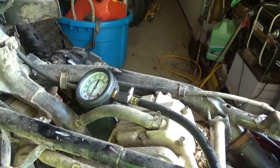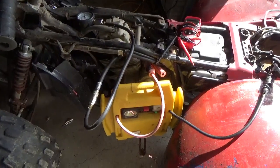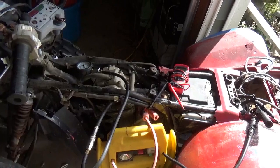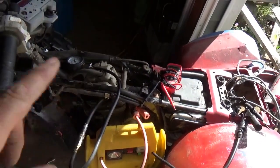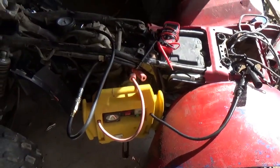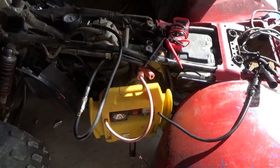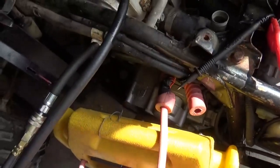I'm going to hit it with a little oil. Let's see what we get. So I put some oil in the cylinder and very gently I tapped the starter, so to speak, and let it go around. I didn't just wing it about with the spark plug hole open, because then it would have shot oil all over me. Amusing to watch, but not much fun. So anyway, now there's oil in there. Let's see what it comes up with.